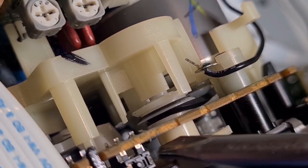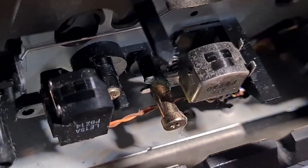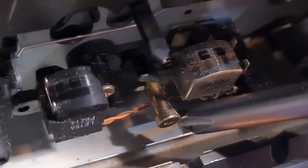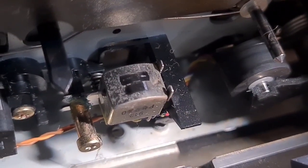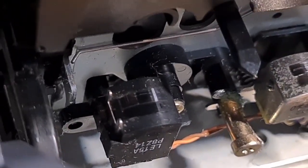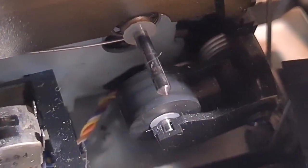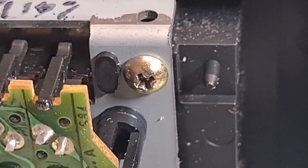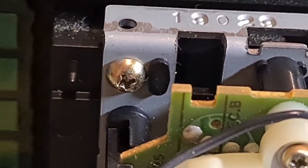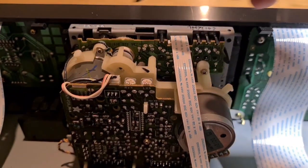It's not just off - it's very loose, right on the edge of being goo. The heads and the azimuth screw are absolutely minging. They need a really good clean. The head isn't corroded but it's pretty disgusting. The recording head looks all right, not too bad, but the pinch roller is very shiny with a lot of rubbish on the capstan too - I'll have to change that. To remove the transport, we're going to take out the top two screws - they look pretty good, no sign of damage.